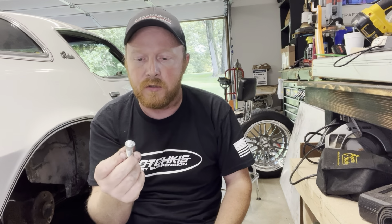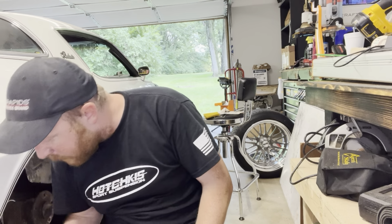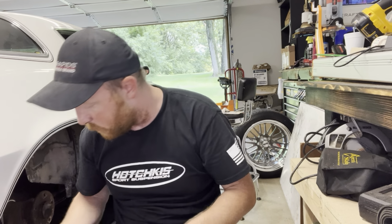And these studs are set up so you drill a half inch hole, half inch stud, and the knurling on it will go ahead and bite in. That's just enough to get this thing in there. And yep, so I'm going to start. I have a step bit, Christmas tree bit, whatever you want to call it. Everybody's got different names for it. So we're going to drill as much as we can because this isn't deep enough for the axle. So I'll drill as much as I can, half inch, and then I will go ahead and chase it with a half inch regular bit here. So I'll throw on a quick time lapse, knock all five of these out, and then I'll go ahead and show you how I'm going to pull those in. So get down here and go ahead and do that.